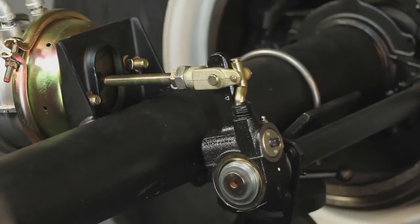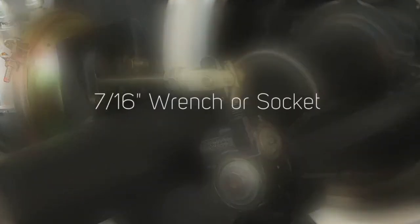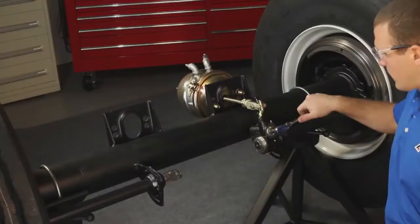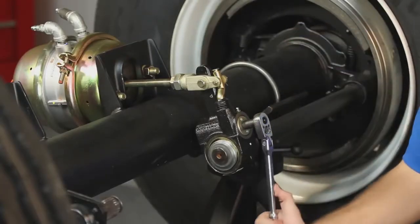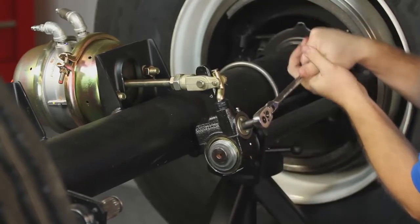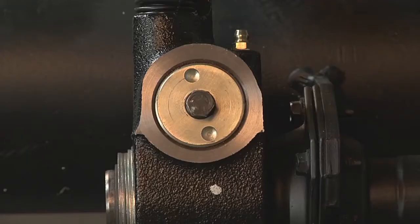Once you have verified the clearance, it's important to do an initial brake adjustment. Adjust the brakes using a 7/16-inch wrench or socket. To achieve good leverage, we recommend an 8-inch swivel head, 3/8-inch drive ratchet with a 7/16-inch short socket. Rotate the hex extension clockwise until the brake linings make contact with the braking surface of the drum. Then back off the slack by rotating the hex extension counterclockwise a half turn. When backing off the slack, you should hear a ratcheting sound. This will require 30 to 50 foot-pounds of torque on a new Gunite automatic slack.